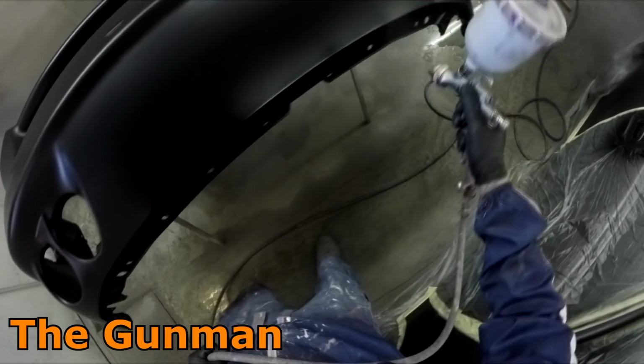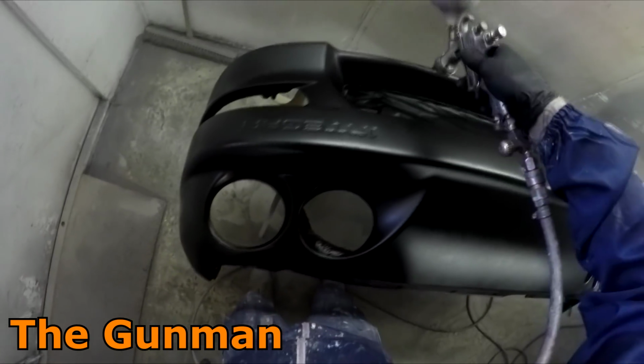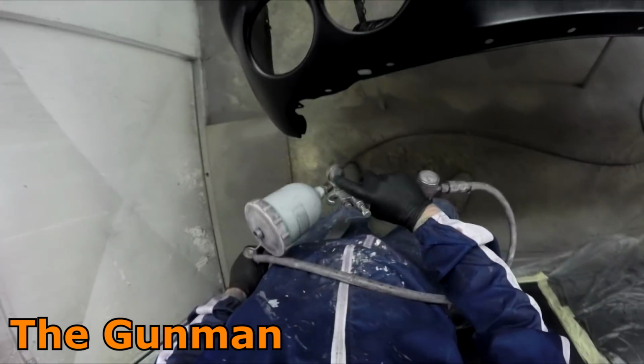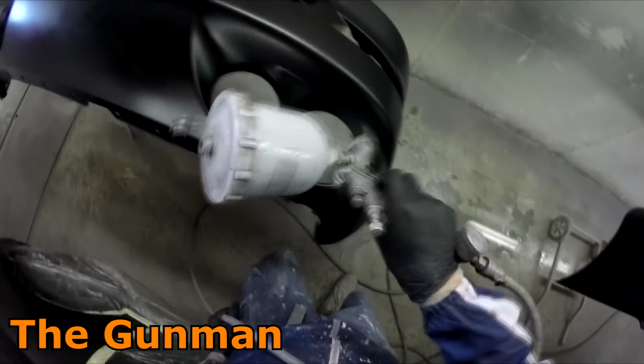And I've even had some people say that their bosses make them sand back every single paint job and make it dead flat. And as far as I'm concerned, it defeats the whole purpose of using 2-pack paint, because the idea is to get it off the gun. You get your gloss off the gun. You also get a finish that is not touched. It's unsanded, so it's not going to shrink back with those scratches within a couple of weeks.